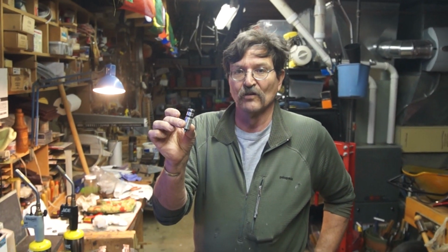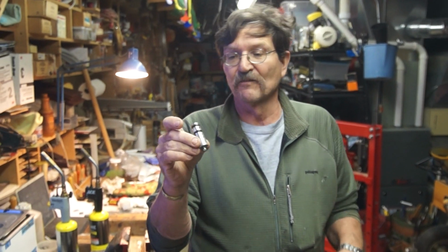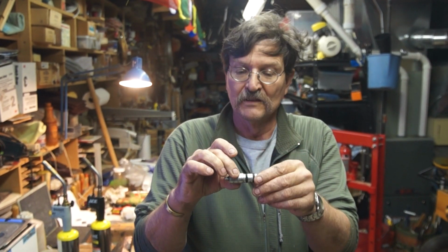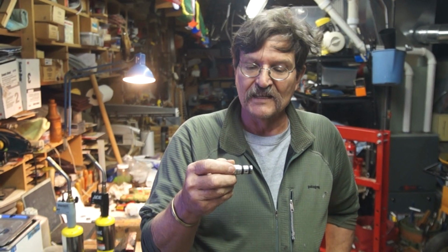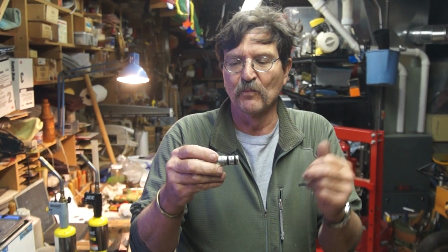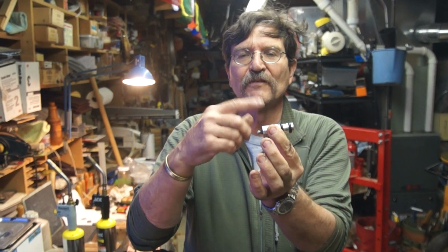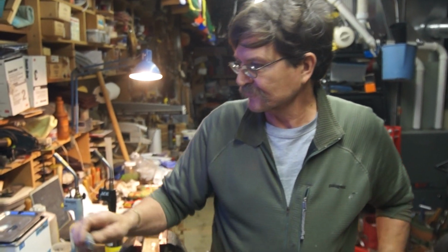This is a greasing tool for the far side bearing. You can get this at Cycle Works. It comes in two different sizes. This is a /5 and later. It's noticeably bigger for the /2. When you have the wheel off, you can put this in, hopefully after you modified the center part that you pull out. It hooks up to the end of the grease gun, give it a few pumps, it stops, give it a few pumps, and hopefully force some grease into that far side bearing.